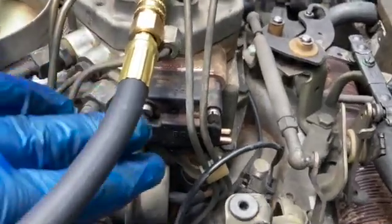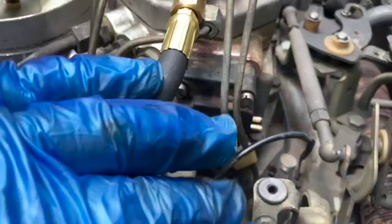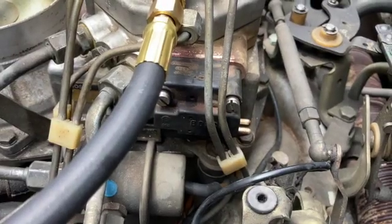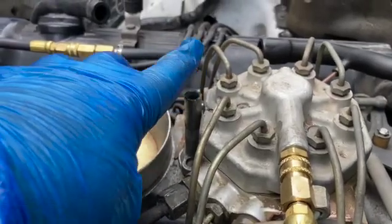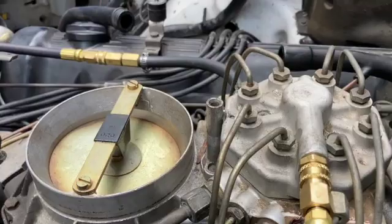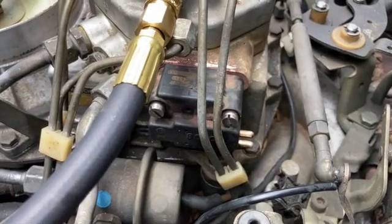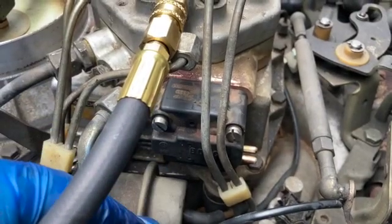Here's the EHA. You test run with it unplugged. The engine should not stall. If that happens, most likely you'll have to adjust your fuel mixture a little bit here, just to make sure that you get it to run at the highest speed. But once you have it running, then you go through the test cycle to make adjustments — there's another video on my channel.